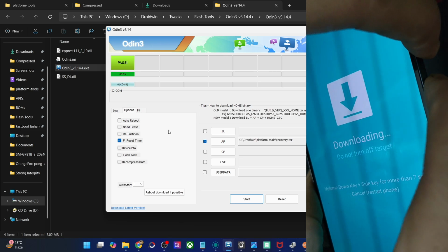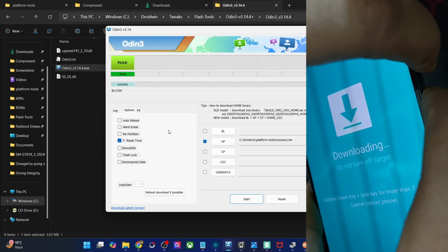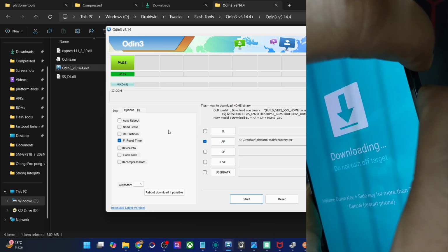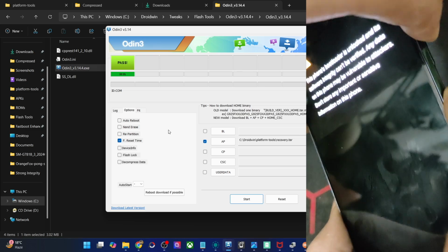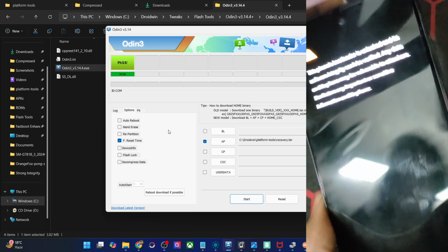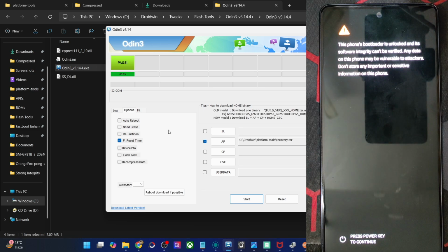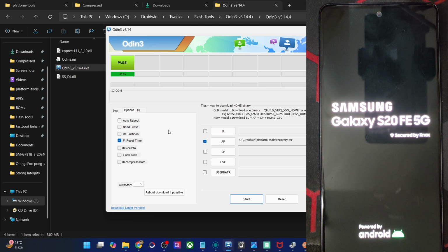First off, volume down and power keys for around 7 seconds till the phone screen goes blank. And let's wait for that to happen. And now press and hold the volume up and power keys for around 4 to 5 seconds. And then you may let go of the keys. If you have done everything right, then your phone should now reboot to the newly flashed Evolution X recovery. But if there is something wrong and you haven't pressed the keys at the right time, then your phone will boot to the stock recovery or the stock OS.